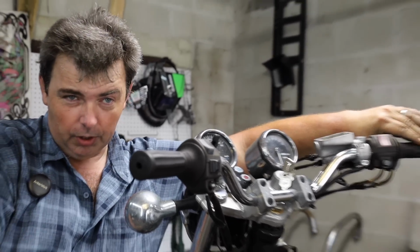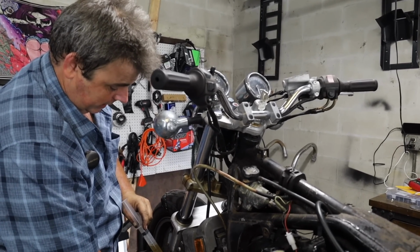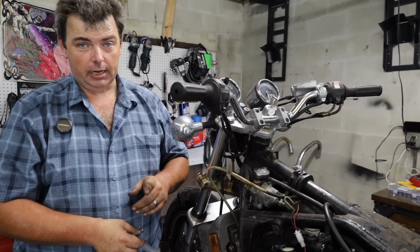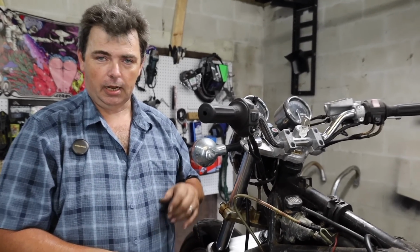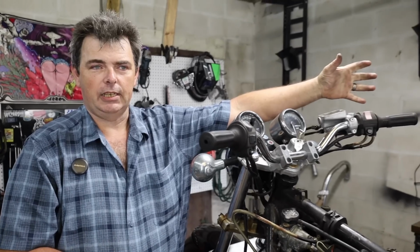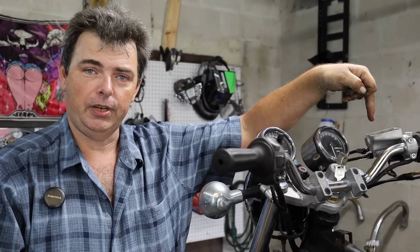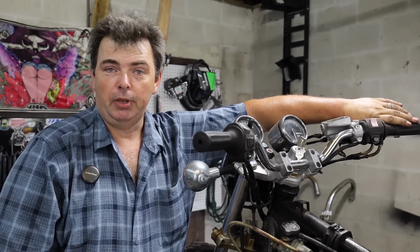If you've got an older bike where, you know, it's been on the road for 10, 15, 20 years, something like that, if your master cylinders haven't been rebuilt, and it's something I've seen several times on Harley in particular because of the way their master cylinder is designed. If you put one of those vacuum bleeders on there and you flip the lever and cut it loose and let it wobble, it'll actually start sucking air around the back side of the piston seal up here on the master cylinder, just because it's got enough wear that it's easier for it to suck air through that seal on the back side than it is to suck fluid down through that little bitty bleed hole in the top of the master cylinder reservoir. So you're actually pulling air into the system.